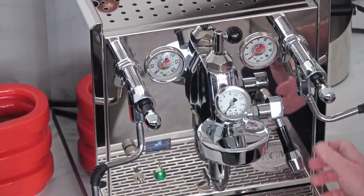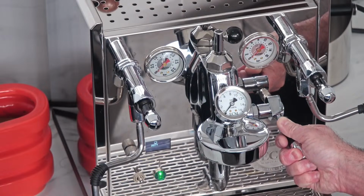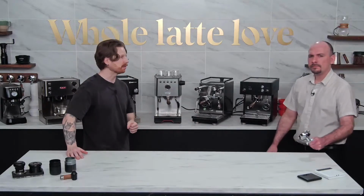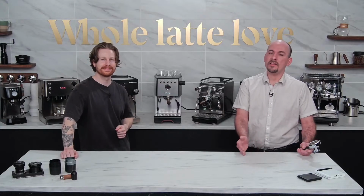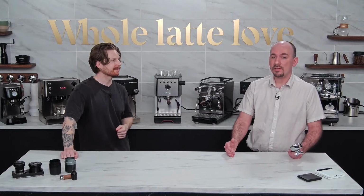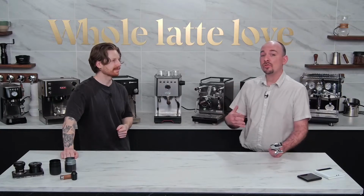For most home machines, we always recommend a 2 to 3 bar inline pressure. Now, there are some commercial machines that you can go a little bit higher than that, but definitely not higher than 4. That would be a little rough. And especially if you're using something like a BWT, an inline water filter, you'll already be reducing the pressure so that you don't harm the filtration membranes, at which point the water going to your coffee will be coming in at a much lower pressure.